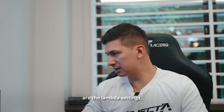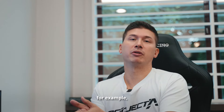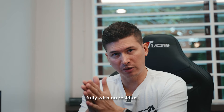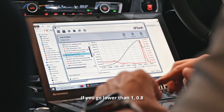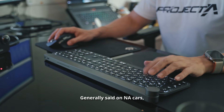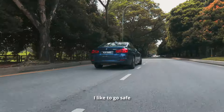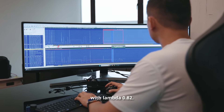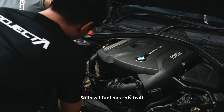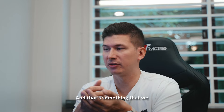I'm touching up the Lambda settings, making sure the engine gets a good air-fuel ratio and proper cooling. Lambda 1 means 50% fuel, 50% air — both react fully with no residue. Going lower than 1, say 0.8, means you have 20% uncombusted fuel. On NA cars, Lambda 0.86 is most efficient for best power. On turbocharged applications, I like to go safe with Lambda 0.82. The excess fuel also provides cooling inside the combustion chamber — running a little richer makes the whole combustion process cooler.